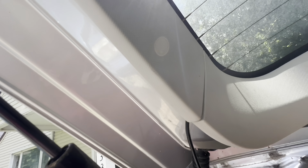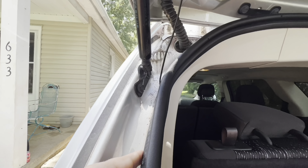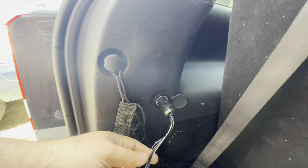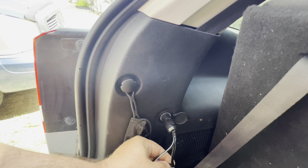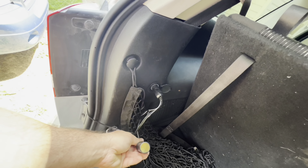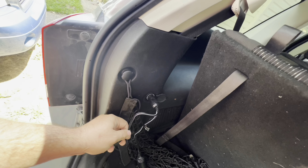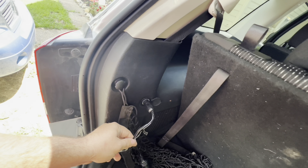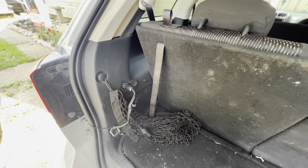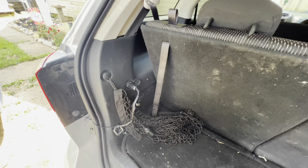The wire comes from the plastic bezel of the liftgate, down around the weather stripping, and down around to the 12 volt plug-in. The 12 volt plug-in provides enough power for the transmitter and the camera. I also used a splitter so you can still use the cigarette lighter, and it's also plugged into the rear camera and transmitter — giving it enough power. That is the workaround for the power problem since it would not work being wired into the reverse backup lights.